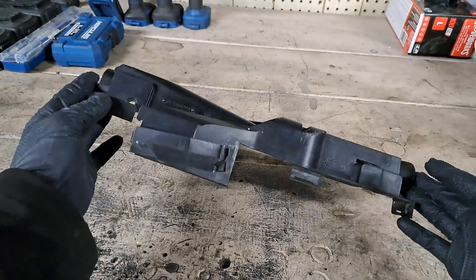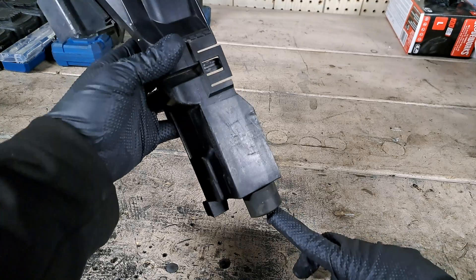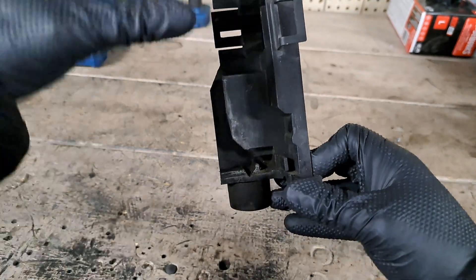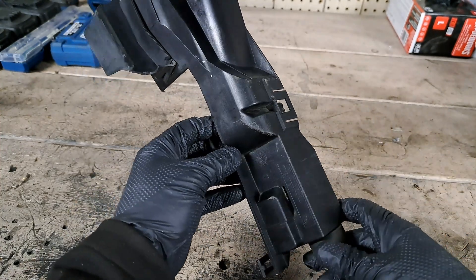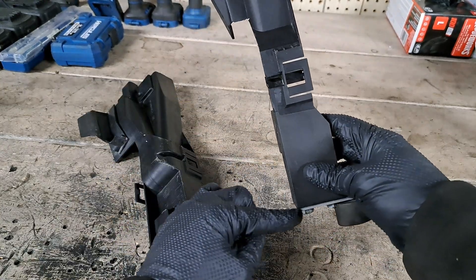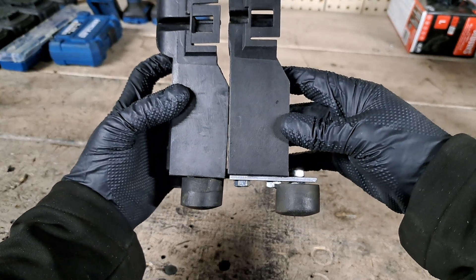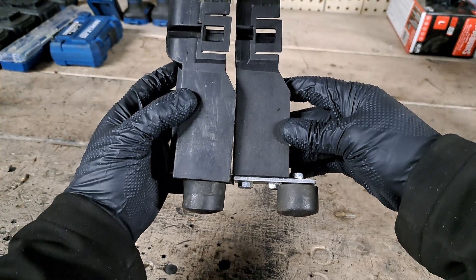Here is one of the mounting brackets used for the radiator on both the X3 and E46. This rubber foot rests directly into the mount on the body and then gets fastened up to the radiator. The radiator rests in the bracket at the bottom in a little V cutout. I had to gain roughly an inch and a half of clearance towards the front of the car to fit the S62. Here's my modified bracket — I chopped off this piece and made a little foot bracket. With the side-by-side comparison you can see how much more forward the radiator will sit — about an inch and a half.